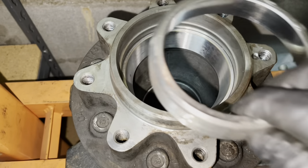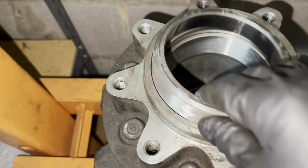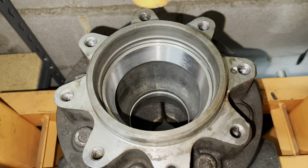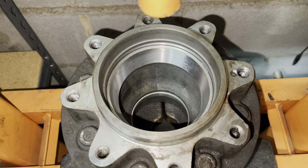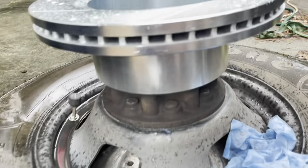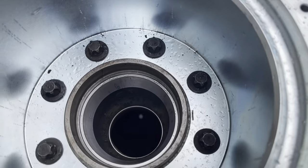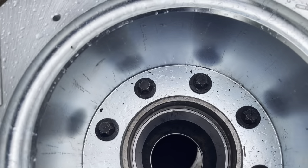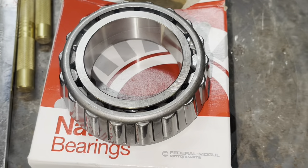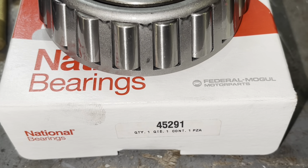The race is pressed down. The tool we ground down has some play in it, slides in, and pushes it past that lip in the pressed area. Get everything cleaned out, then move on to assembling the rotor to the hub assembly. This is why we said to stack the tires earlier — you can lock the hub into the tire and torque down those eight E-style bolts with a 14-millimeter to 114 foot-pounds. Torque them all up with some Loctite and you're done.